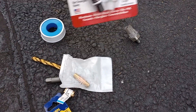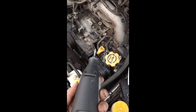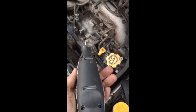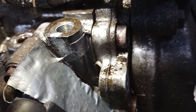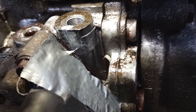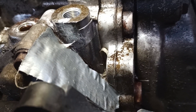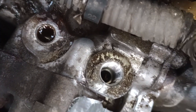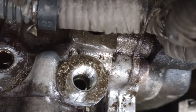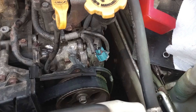To top it all off we've got some JB Weld and some Teflon tape. You'll also need a Dremel to clean up the area. As you can see we roughed it up a little bit along the crack with the Dremel — we might do a little more on the left side. Here's a clip from the top; it looks like it only cracked on one side.